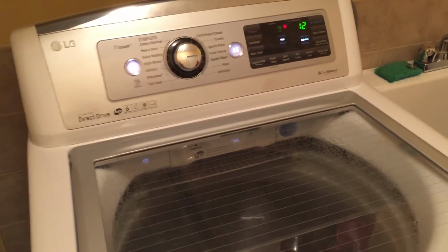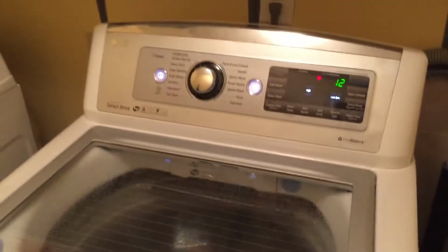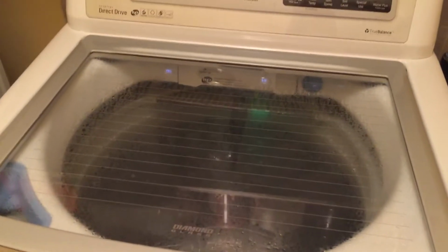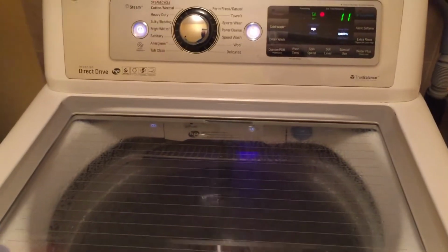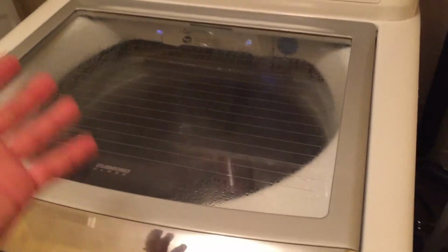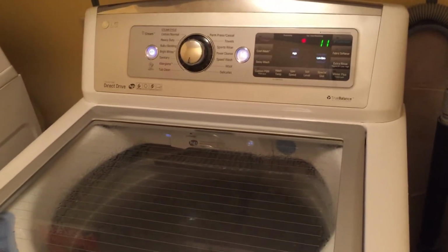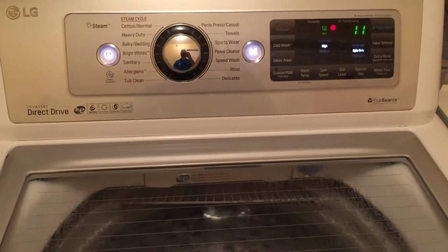And the more you invest in them, the more you're going to just end up paying for a new one, because they're unrepairable for the most part. To get the bearing out of this thing and replace the bearing underneath is going to be a huge amount of labor. Even if you can get the part for, let's say, $100, $150 as an assembly, you've got to basically tear the entire machine apart, which costs hundreds in labor and takes quite some time. And then you face other problems. For example, if they fix the bearing on this thing and then soon the pump went, then what good is it? So you can see it's just not practical to do.